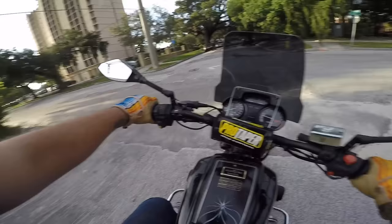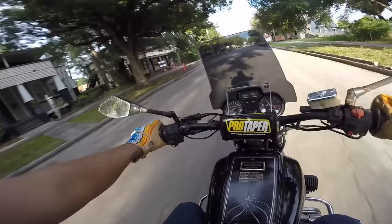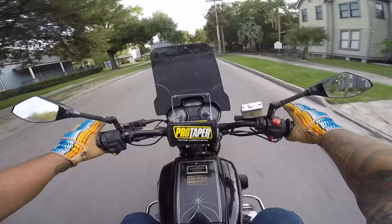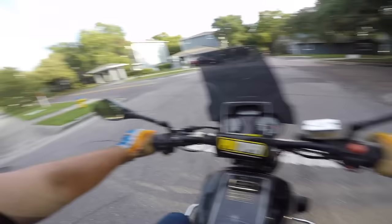Well, I mean, not exactly like it should. You know, it ain't no freaking badass suspension or nothing, but it's a whole hell of a lot better than what was on there before. And you can get gold valve emulators. You can certainly get those for the air forks that were on there. The problem with the gold valve emulators on those forks is they block off the oil passage under braking. It's this anti-dive technology thing. And I'm telling you, that's not what you want to have off-road.